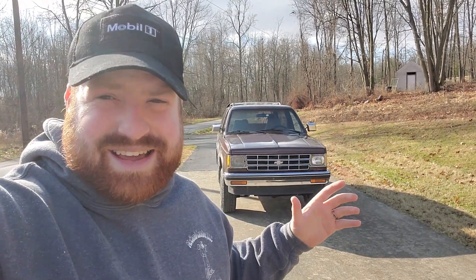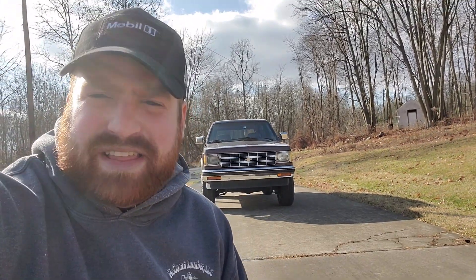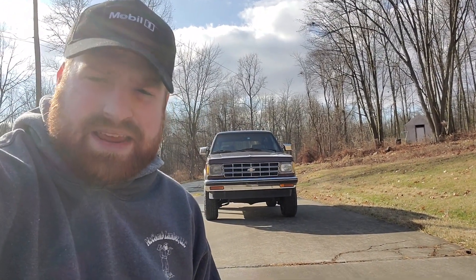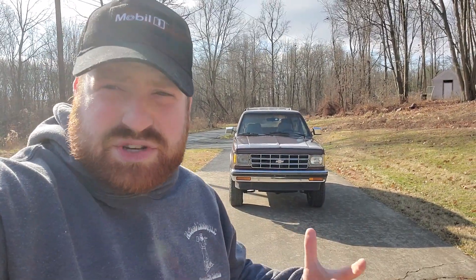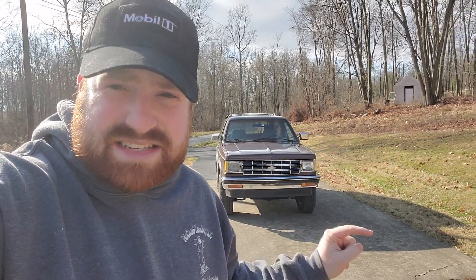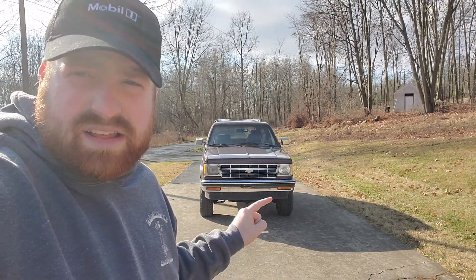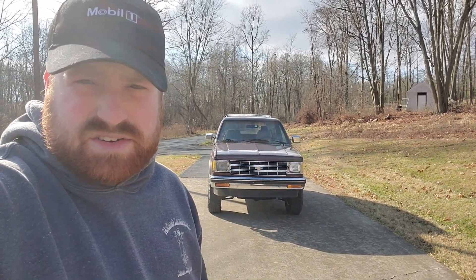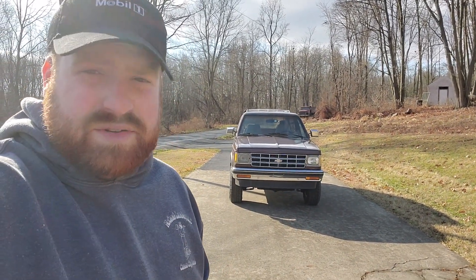So I'm actually incredibly happy. We have so far done a little bit of a lift to the Blazer. We took the stock torsion keys up the whole way, we put lift shackles in the rear, and it sits really, really nice. This is our biggest thing I've done to the Blazer yet. The only other thing I've done since I bought it — I bought it for $400 — I've driven it for like three or four months now.